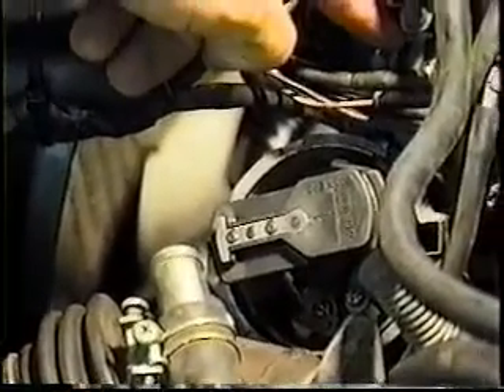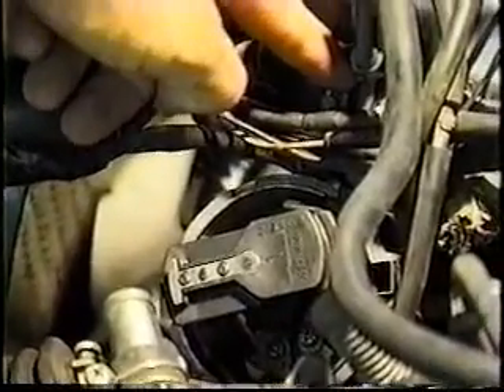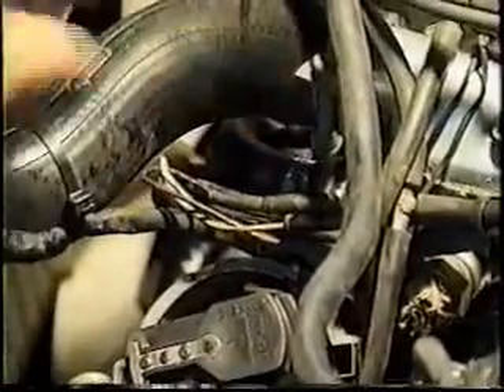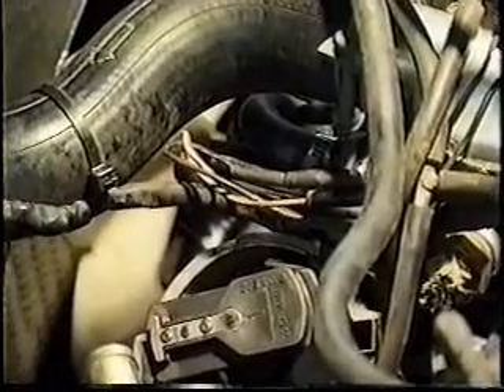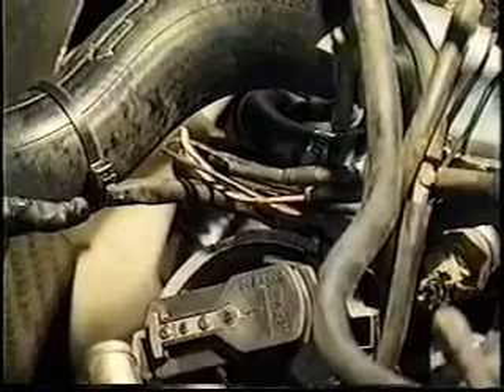That's the brains of this entire outfit. If there ever was a boss in this fuel injection setup after everything's working, it's it — everything answers to it, except for a very small trimming amount that's done with ambient air temperature, and that's the intake air temperature working through the airflow meter.